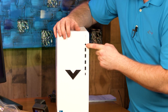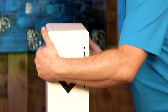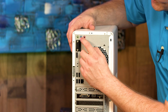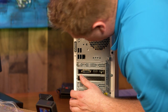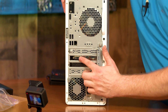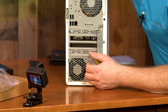Starting from the front: this is your power button, and this is a headphone and microphone combo TRS jack. We have four USB 3.2 Gen 1 ports and a USB-C 3.2 port — these are all five-gigabit ports on the front. Coming around to the rear, at the very top we have our headset auxiliary line port and microphone, and then our 92mm rear fan. We have a 10/100/1000 Ethernet port, four USB 3.0 ports in the rear, and our GTX 1660 Super which supports three monitors — a DVI-D, an HDMI, and a DisplayPort. Our power supply is right here, supposed to be a 500-watt bronze unit.